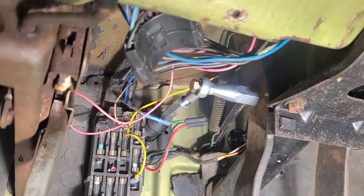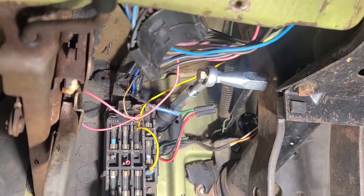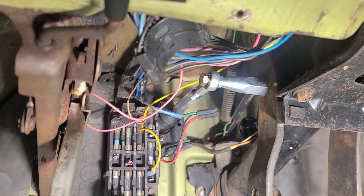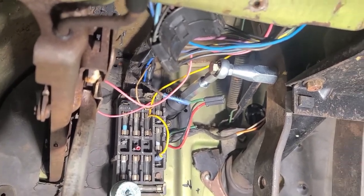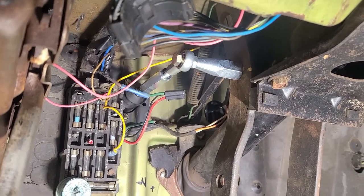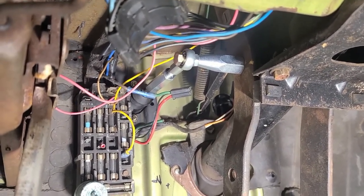I have a right angle head drill, only 3/8 chuck, which is fine. Did a pilot hole, stepped it up to like a 3/16 hole, and then the bigger bit was too long to fit everything in there, so you're going to need a step drill to come through there to give you enough room for the drill bit itself.